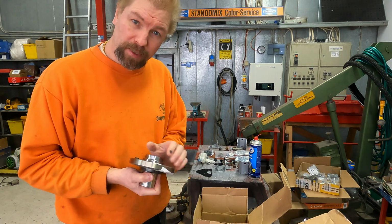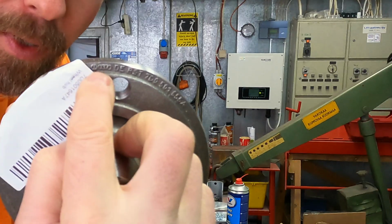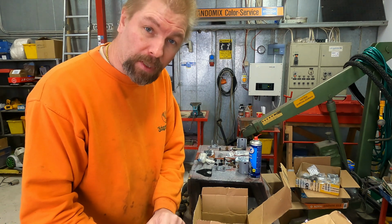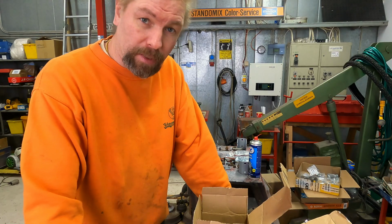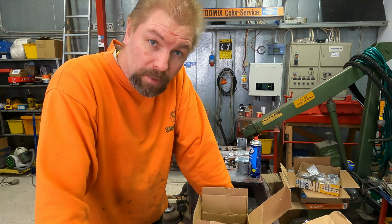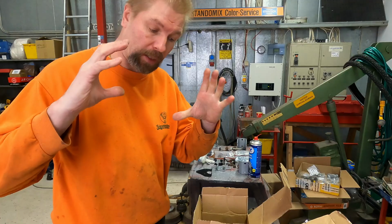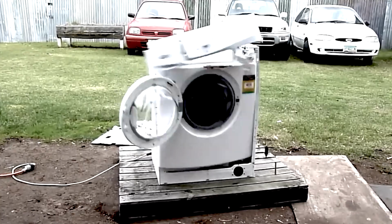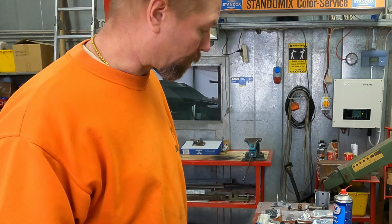So I got a little bit of new parts, and good news, I have all 4 wheel hubs, and these are original Volkswagen Audi wheel hubs, which is nice. I lost a little bit of money for these, but in my Cadillac 59 I had problems with very small wheel vibration. Now it's better than anything. There are so many ways where a vibration could come from. There is a problem just centering the drum brakes, and drum brakes are very huge and very heavy. The original wheels also are not 100% straight. I don't need any issues with vibrations. If you would like to travel around the world with this car, driving several 100,000 kilometers or something, you don't need vibration.